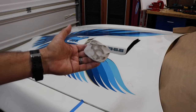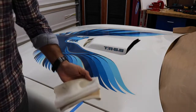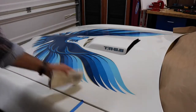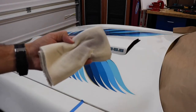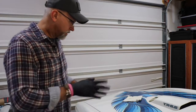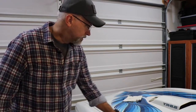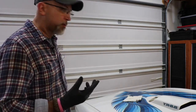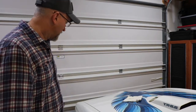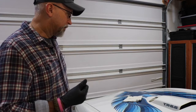The thing we're going to do, put some solvent on the non-tinted microfiber, and let's give this area a nice wipe down. And what does that do? Just like washing the car, but look at the black. I can do this a lot faster than I can play the entire thing. Okay, so we've got this section of the car wiped down with the body solvent, and it's nice and quiet. You don't feel any overspray. That took probably 5 minutes elapsed time. I might find a way to tape that better next time. So it took about 5 minutes to wipe this whole quarter down, and now I'm going to go back with a very easy abrasive.